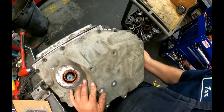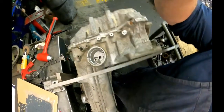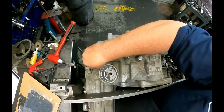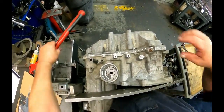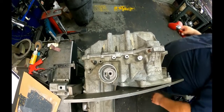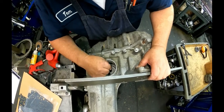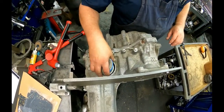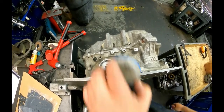I guess all we've got left is a linkage seal and a reverse servo. It's the same installer for all your GM lever seals. Now, you're going to have to look down inside here, make sure that your band is lined up in the groove, because if you don't, you're going to miss it. Put your servo in. Lube up the O-ring.